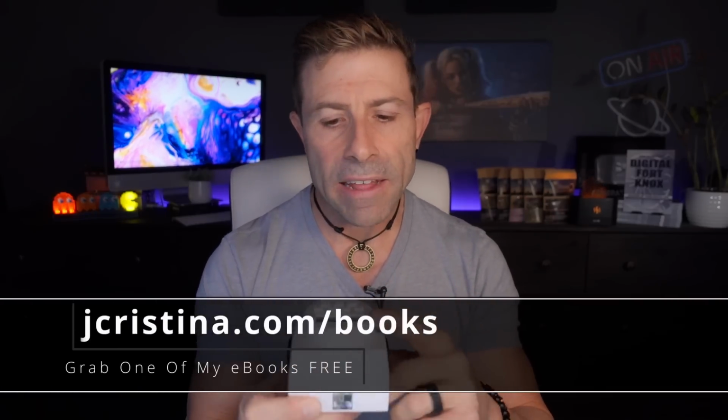You plug this into not your wall, guys. You don't plug it in the wall. Where do you plug it? If you don't know, watch my last two videos where I got hit by lightning. You plug it into a UPS, right? You plug this into a battery backup, and then you plug your Starlink into here. Don't get your stuff blown up like I almost did. Anyways, I'm going to show you exactly how to set this up.